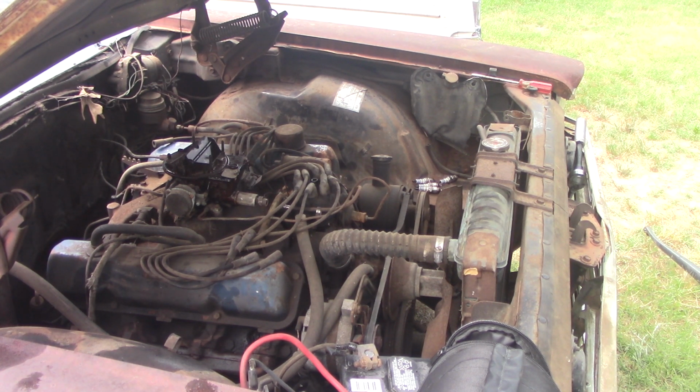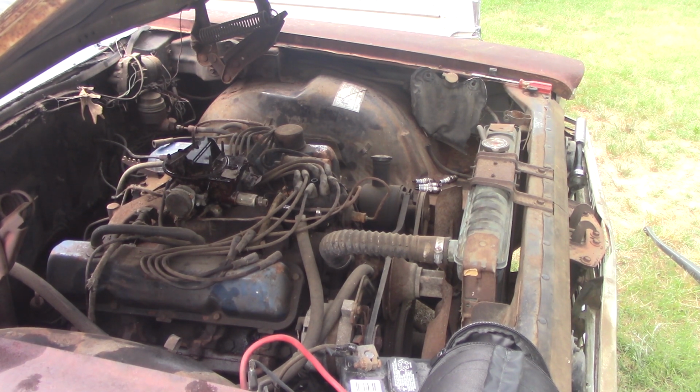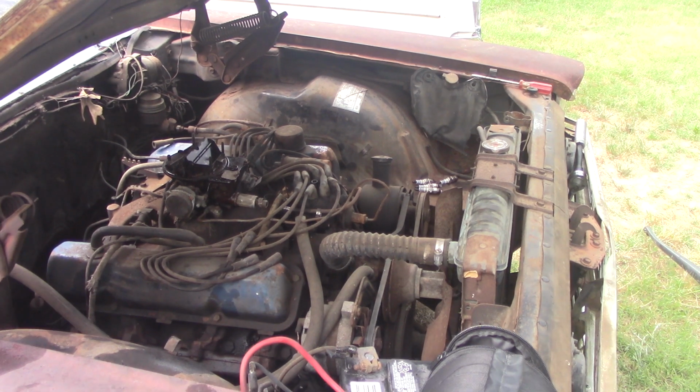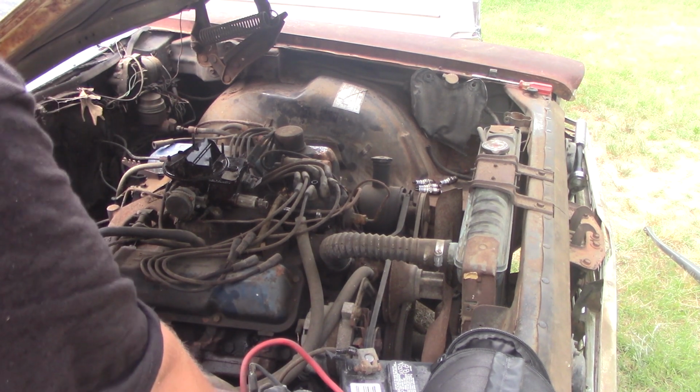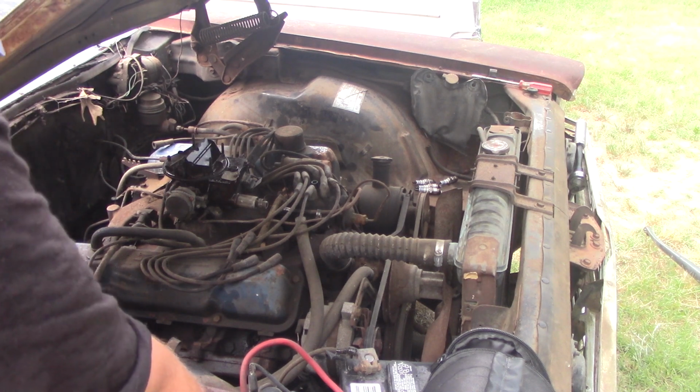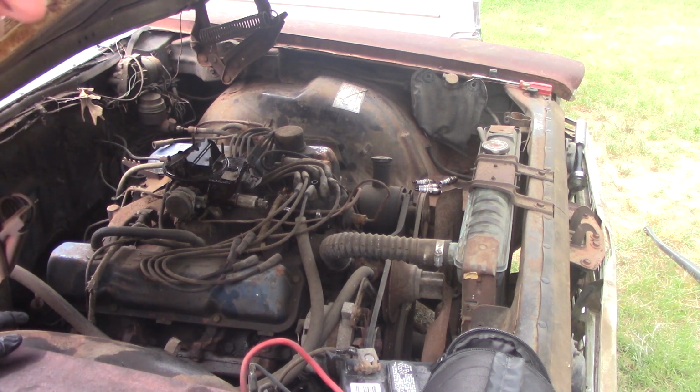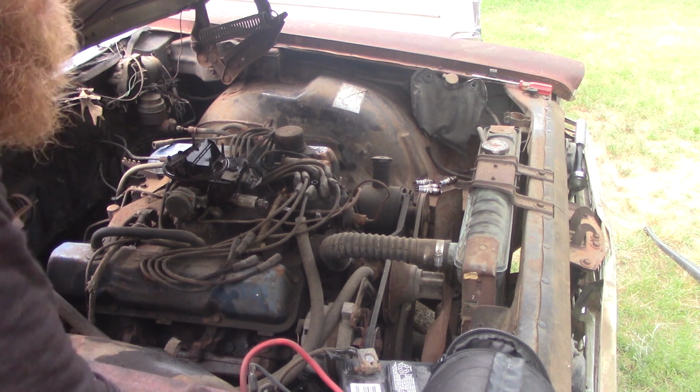Okay. Lots of parts in the bench. It is not sanitary anymore. Alright, I'm going to ignore all of the diseases I could catch. We have lights. Alright, so solenoid is my suspicion, because we're getting power to the car. However, I'm getting absolutely nothing when I go to turn the key, not even a click.